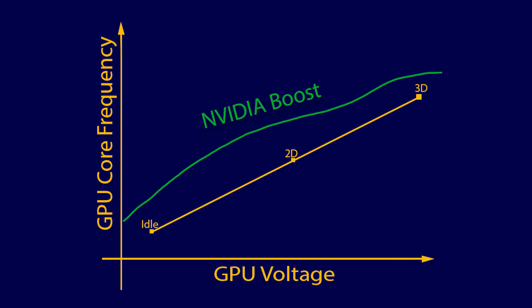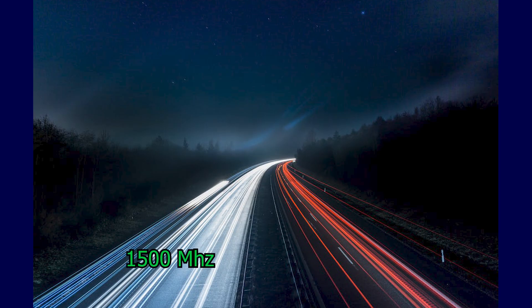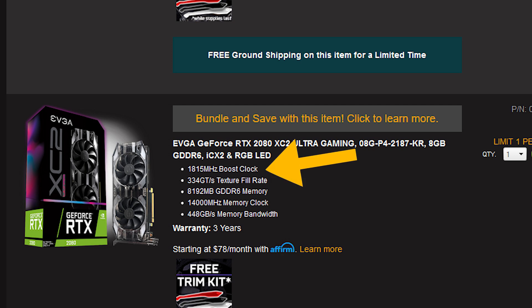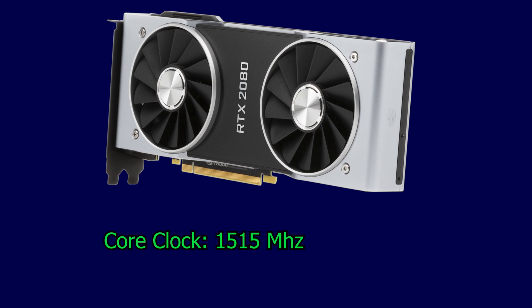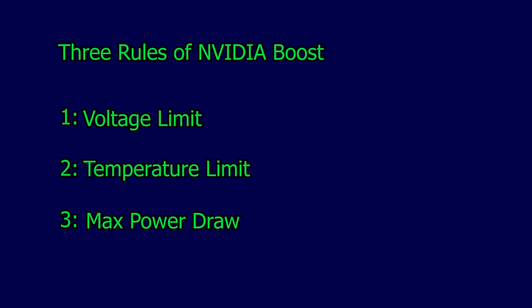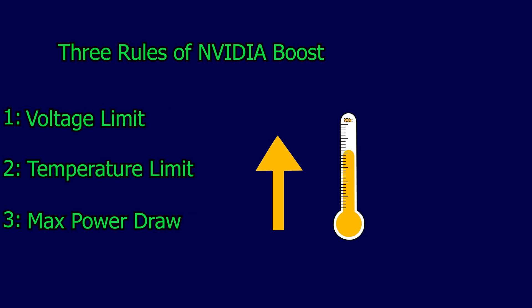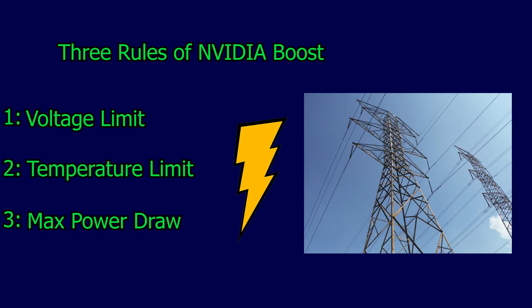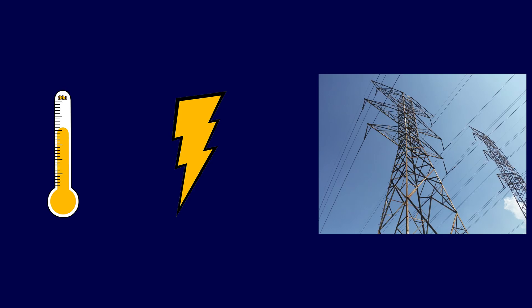But it goes one step further than what people are used to. Your core clock speed might be 1500 megahertz and it will turbo up to 1800 — that is normal for a video card when you're buying one. You usually have the overclocking model, the extreme model, the ultra model, and they all have different set frequencies. The way Boost works is basically anything above the core speed is considered boosting, and it does that on three principles: power draw limit, voltage limit, and temperature limit. If the video card is at a low enough temperature, it will boost higher. If the video card is not pulling too much power, it will boost higher. If the voltage limit has not been reached, it will draw higher voltage and the frequency increases.